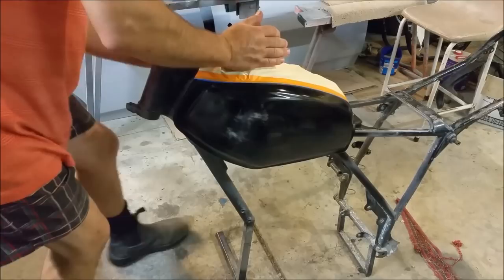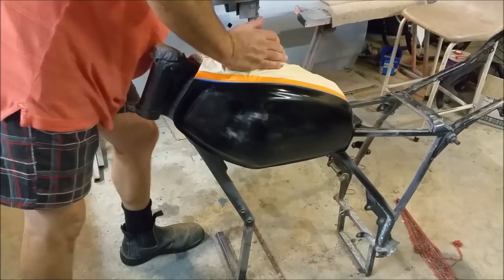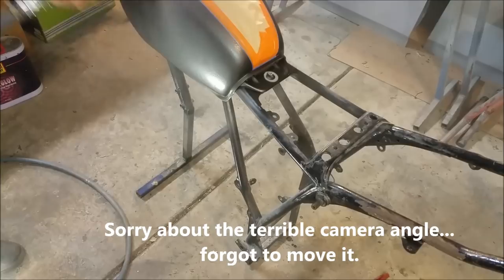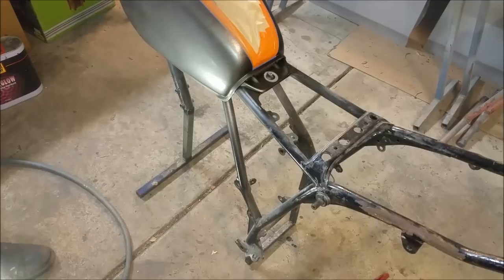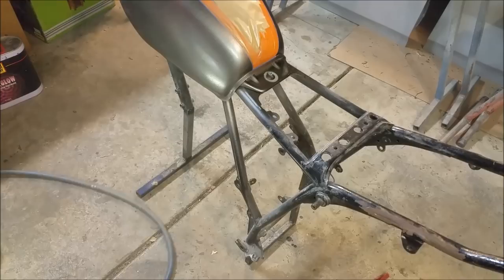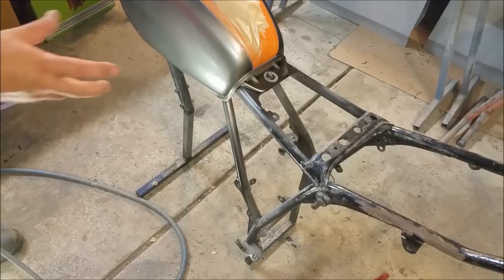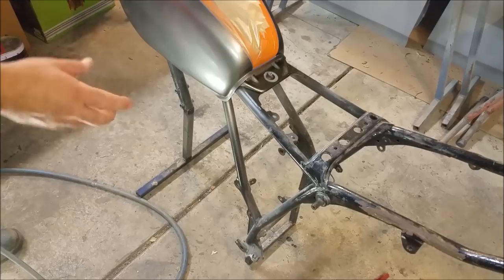And I think now is a great time to start shooting this colour. Just a light coat for the first one. And we've got to watch that we don't get a wet edge, because otherwise you can end up with a fuzzy stripe of metallic particulate in the center. So we can put down a heavier coat next, and then afterwards we have to dust it on to make sure that's all really random. But you'll notice the silver covers the black beautifully.